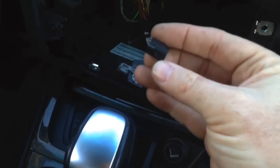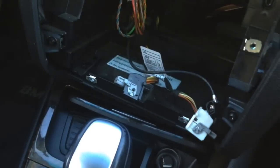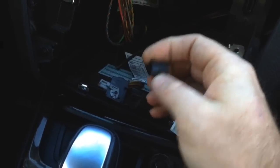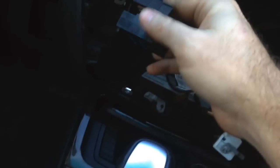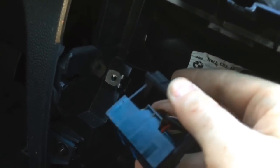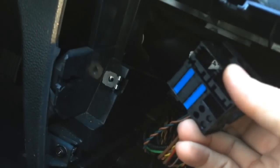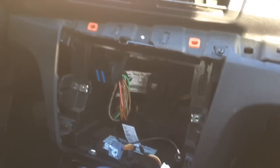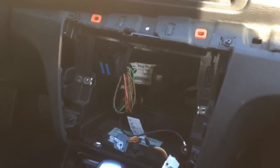Here we are with the radio uninstalled. The antenna plug has a little squeeze connector — push the little button and that releases it so you can pull it off the antenna. The main plug has a little slide bell. We just took our thumb, pushed back, opened it up, and pulled out the back of the stereo. That is the radio/stereo/climate control HVAC removal on the BMW 1 Series. Thanks for watching.